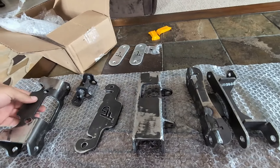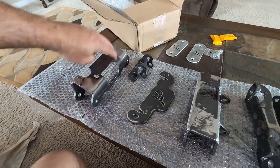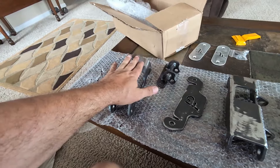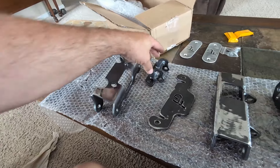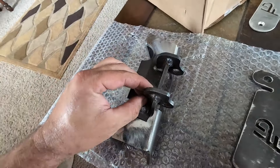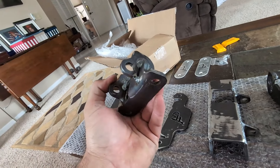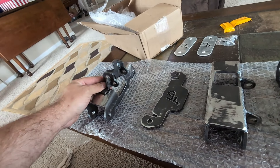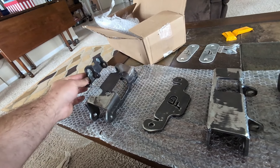Here's how I think it works. I think these are cut out to go around the frame bars, and these are your factory front diff bracket holes. So this goes in and reinforces your front lower control arm tabs, then ties into the frame — super beefy. Then this goes on here because these line up; it's like a puzzle. That is a new front differential bracket that reinforces the stock flimsy Honda one by like a thousand percent. So now your front diff is really going to be solid, because you only have two diff mounts on these things and the front one's pretty puny.